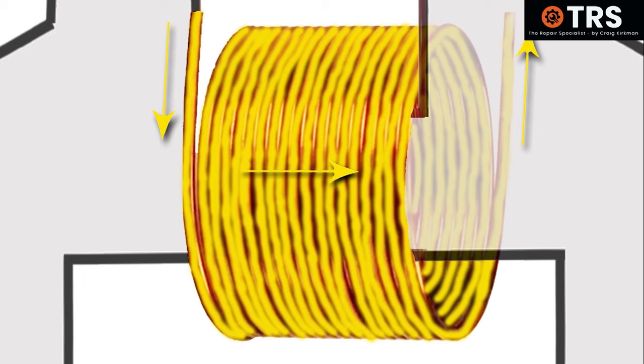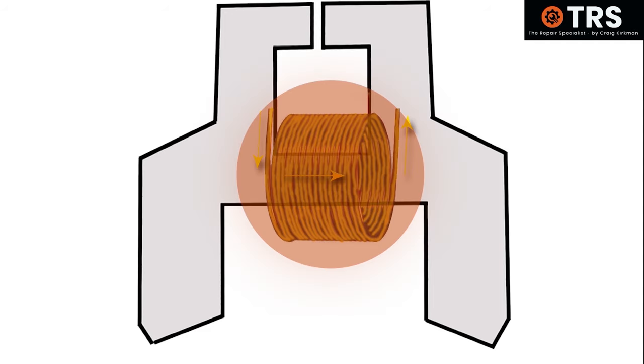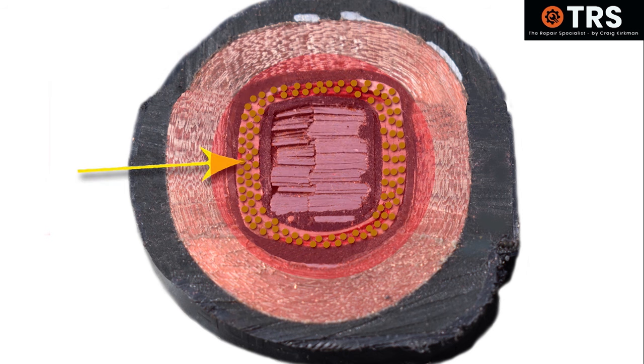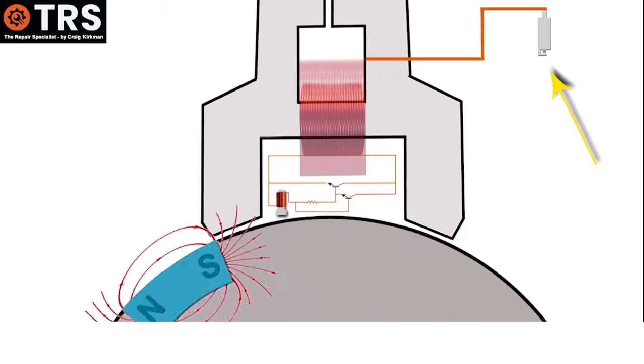Let's say the optimal amount of electron flow current was somehow disrupted in the primary coil — say there's less current going through it, what would happen? This would undoubtedly have an effect on the strength of the magnetic field produced by the primary coil. What effect would that have? If we now have a substandard electromagnetic field — much less than what this coil requires — it's not going to have the same coverage over the secondary coil. When it collapses down to the iron core, it's not going to have the same strength to excite the electrons in the secondary coil, so those secondary coil electrons won't upregulate to a high enough voltage to produce a good sufficient spark for the engine.